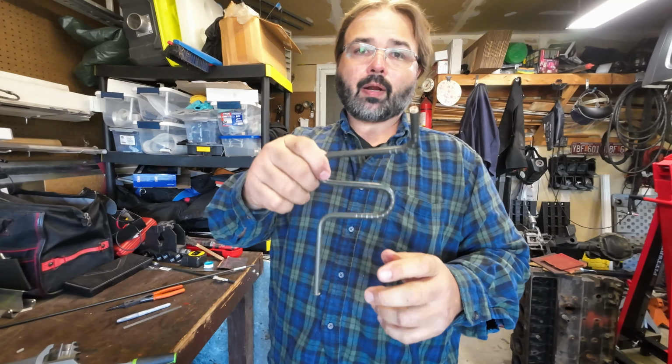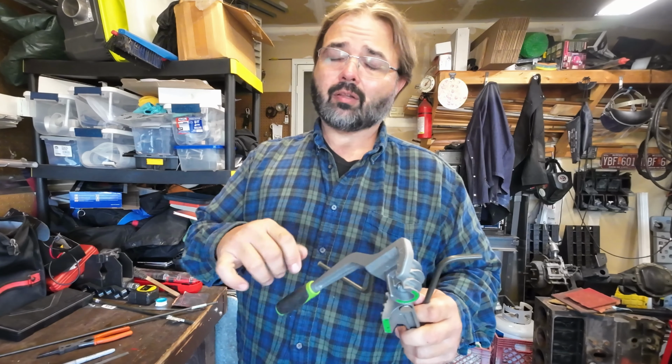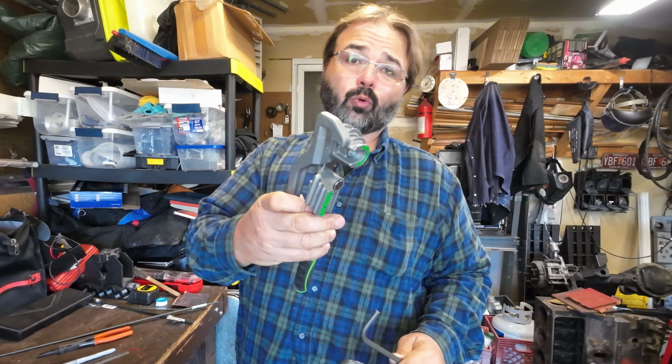A simple little bender. Now, if you're doing real thin, like 1/8 inch lines, you can get the spring type benders without a problem. You know, if you're doing the bigger lines like this one, do 1/4, 5/16, and 3/8 line. That 3/8 line's a hoss to bend.